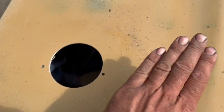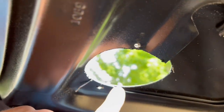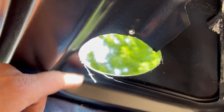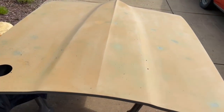Now again, don't wipe this metal off. It'll just scratch the heck out of your surface. You know, compressed air, blow it off or something, but get that stuff off there without scratching the paint. And on the underside, that's exactly what it should look like right there. Now I'll clean up the edge here a little bit with a file. I got a little bit of little cliff hangers hanging on here, but other than that, we're ready to go ahead and wipe this thing off, put it back on the car, and get it painted.